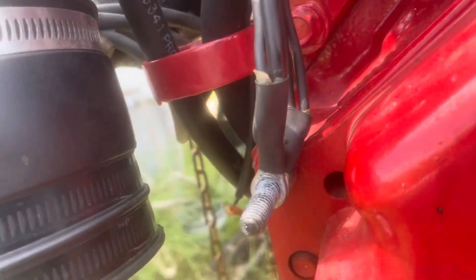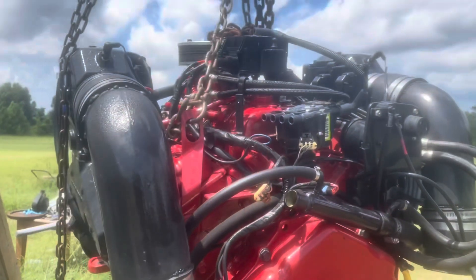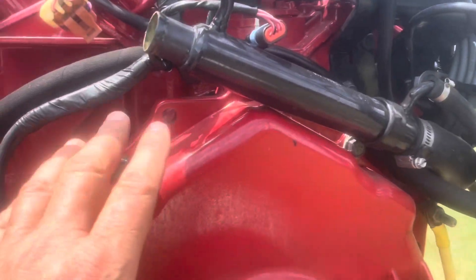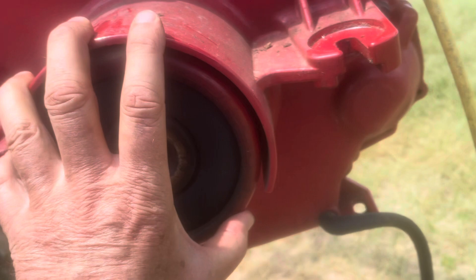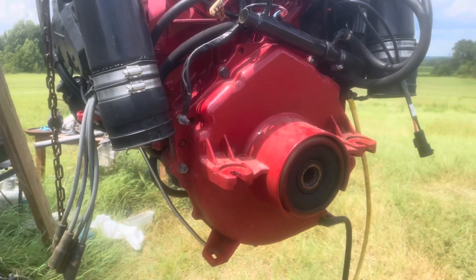All the bolts and things I took off were still in the boat. That's about it — I'm going to start tearing it down and get it inside the shop where it's cool. I can't put it on a stand yet; you cannot put it on an engine stand until this rear cover comes off, the coupler comes off, and usually the flywheel has to be taken off also. So I'll be taking off the rear cover and getting the flywheel off and putting it on the stand.